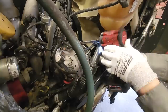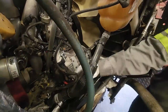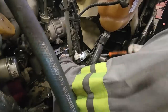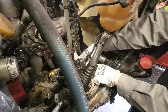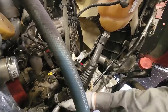So what we're doing here is pulling the alternator. A lot of times I like to pull the wiring off the alternator first, but on this one I can't really get to the wiring that easily because there's so many hoses and stuff in the way. So what I'm going to do is pull it and then pull the wires off. I am going to be trying to pressure test the EGR cooler by itself, so I need to pull this alternator out of the way and then the bracket that holds it on to hopefully get to the coolant tubes that go to the EGR cooler.